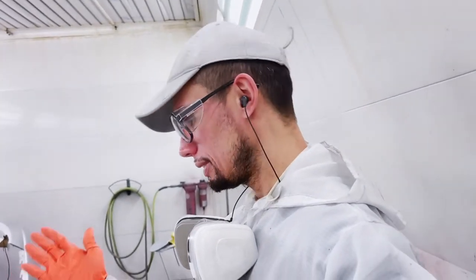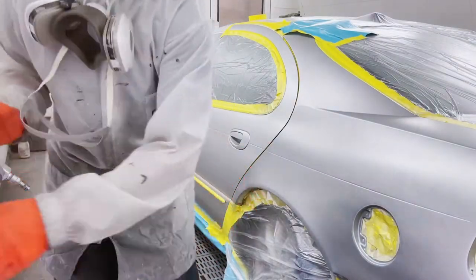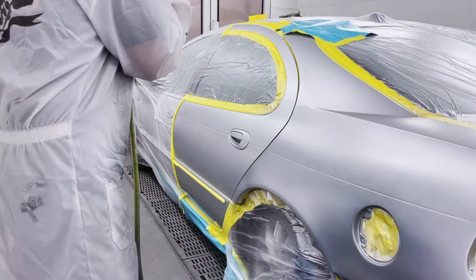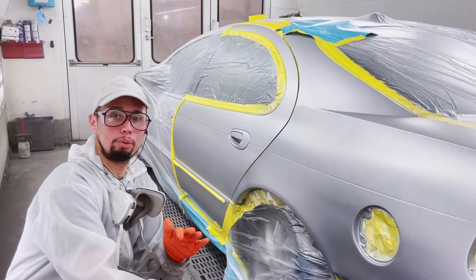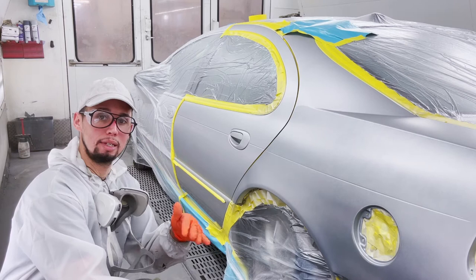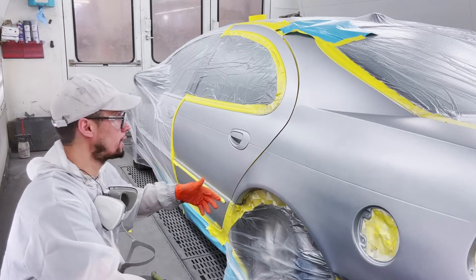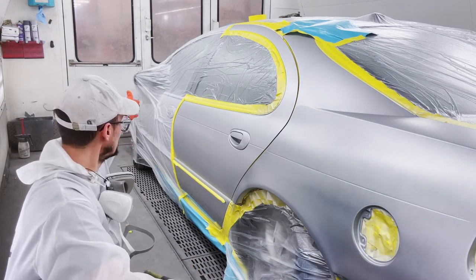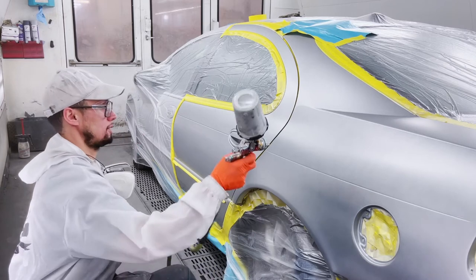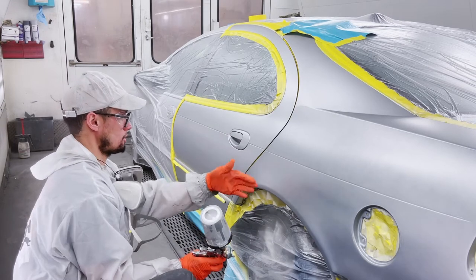To break it down, that's pretty much how things happen in the paint shop. I'm going to show you what I mean when I'm blending this panel while the booth is off, because if the booth is on, you're not going to hear anything I have to say. I keep the pressure on my gun fairly low, between 15 and 20 PSIs, so that when I try to blend it, there's not too much overspray going this way, and it keeps paint from accidentally moving into the front of that panel. This is what blending is — I got my pressure low and I'm softly putting the paint on here to transition this panel to this panel.